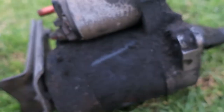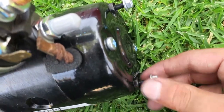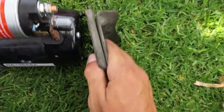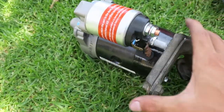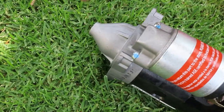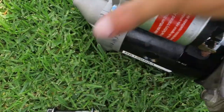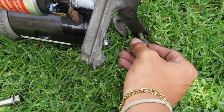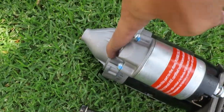It actually had another 8mm bolt, so we didn't really need to take off that first 8mm - just the 14. Here's the new starter from O'Reilly's. Let's put the old bracket onto the studs. Move the last 8mm off the bracket, unscrew these 8mm bolts, and the bracket seats the same way. Screw both of the 8mms back down and tighten them. Now it's ready to go back onto the car. The game plan: the two top screws are threaded but the bottom one is not threaded, so I'll put the starter inside the bay, make sure the gears line up, slide it through the bottom hole, screw in a few threads into the bracket for support, then grab the nut, tighten it, and put in the two screws.